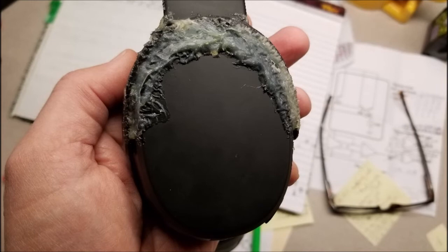You will get better with practice. This was my first attempt. I put the epoxy in a styrofoam cup and it melted the cup and polluted my epoxy — you can see how it modified the color. I also took too long on this particular side so it looks much rougher than when I did the other side. Frankly this side looks horrible, but if you do it right the epoxy will take on the color of the surrounding plastic and dry clear. If you're crafty you could end up with a really nice looking job that few people wouldn't notice any difference in.